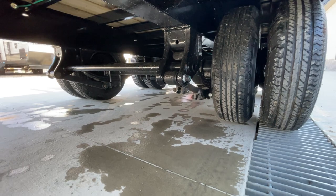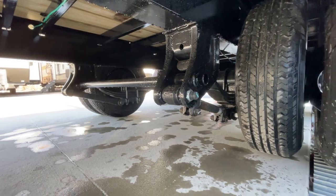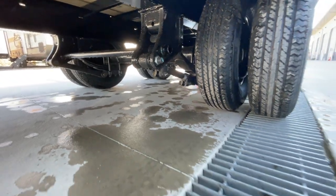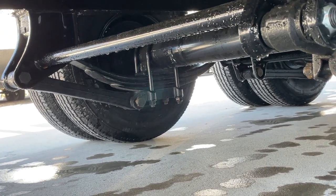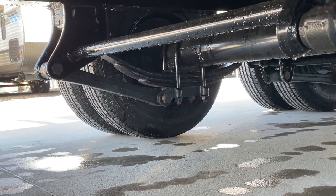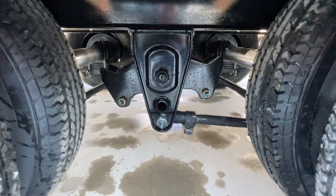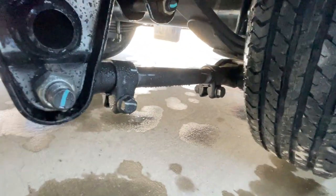This is definitely one of the key things different on this versus most trailers: HDSS suspension, standard equipment. These are a lot heavier hangers than what you'd find on a typical trailer. It's also an adjustable trailing suspension, and it's 100,000-pound tensile strength steel — not mild steel. It's got a heavy-duty three-leaf suspension, not your typical trailer suspension. This is basically similar to the Hutch 9700 suspension found on semi rigs that are not air ride. Let me take you to the center hanger — that's your center slipper. If you look at a regular slipper spring suspension, it looks much different.